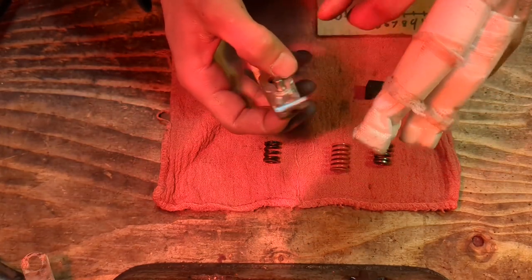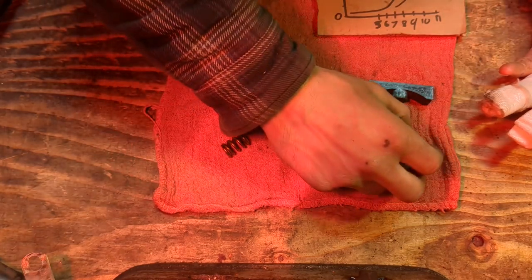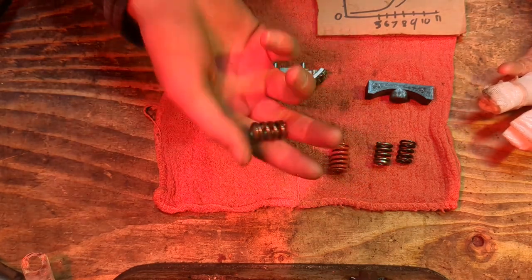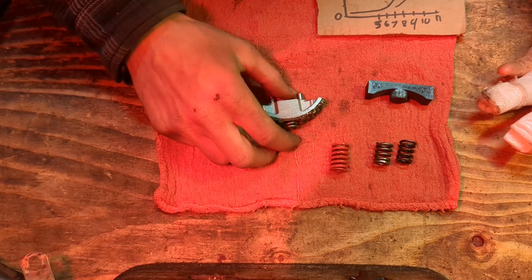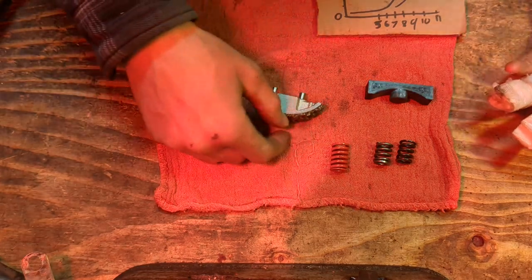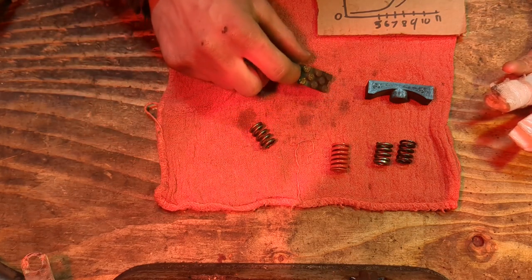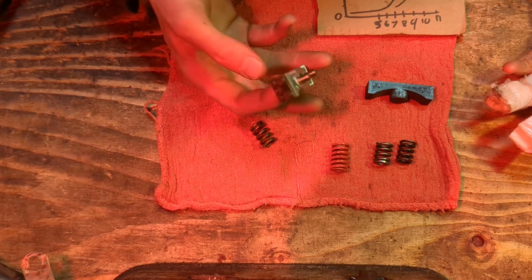In my opinion, though, this is going to revitalize the old platform for those that want to race and practice on the cheap. If you use this spring, you can add washers to the stack and squeeze it harder, and you can get a fairly good high sevens, low to mid 8,000 RPM lockup, which is a fairly conservative lockup if that's your goal.